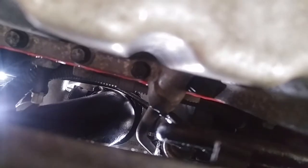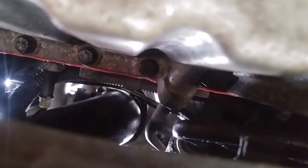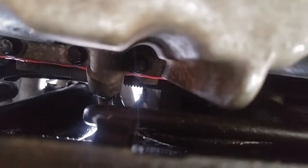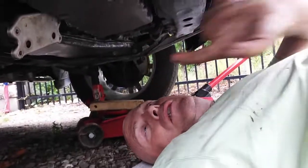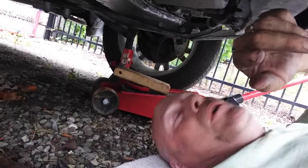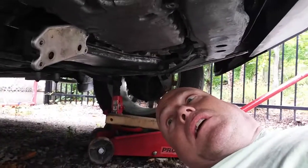So if this will focus — there we go. All that stuff oozing out is that gasket that I installed. That's perfect, that's exactly what you want to see: that nice even ooze out. Down here too. There are some spots there that I thought the gasket or the pan touched, but it didn't. Doesn't matter, I'm going to leave it. This side, same thing — except I've had my arm up in there and rubbed it off. That is good. Pan is on. I'm going to leave the oil filter off so I remember to put oil in it. Leaving the oil cooler off so I remember to get a clamp. Got my motor mount on. Everything under here is done, except for those things. Now I can get at those turbos.